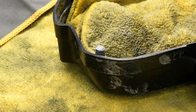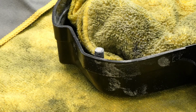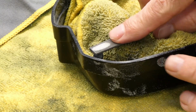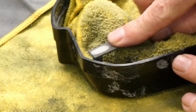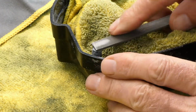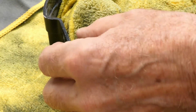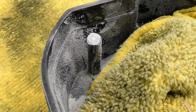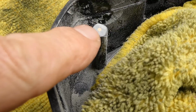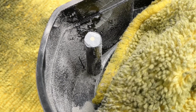Be careful not to take too much. Yeah, I need to have it nice and flat now. Next tool. So I've got this standoff at the height I want it, and I think it's reasonably flat. So now I want to drill that toothpick out to set it up so that I can tap an M4.